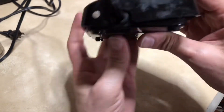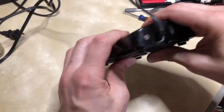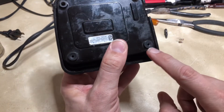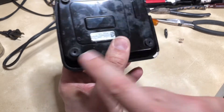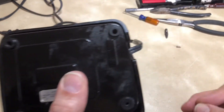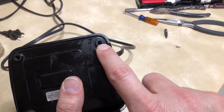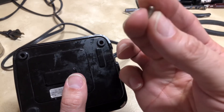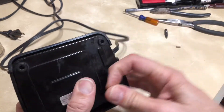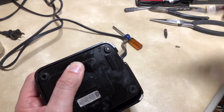The pins are in but not yet secure. It pivots on these pins and the springs seem happy, but we're not done. There are two places here under the little rubber feet where the specialty screws go. Take the screw with the narrow bullet end going in first — make sure the head where you'll be tightening is on top. Hold the clamshell still and put the screw in, using a screwdriver that is the right size.